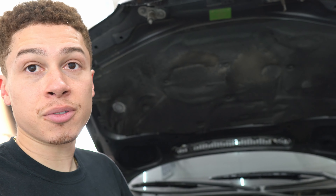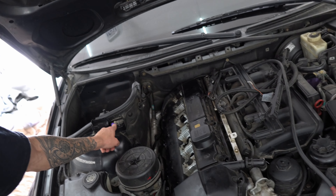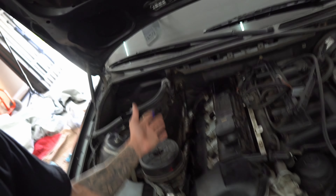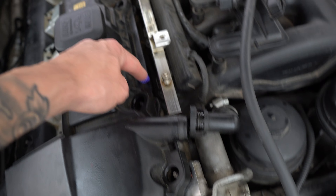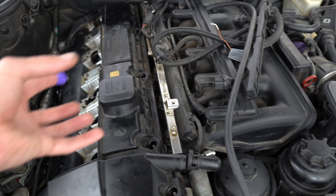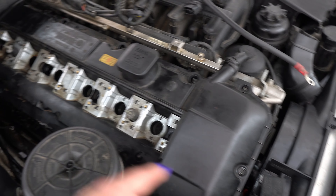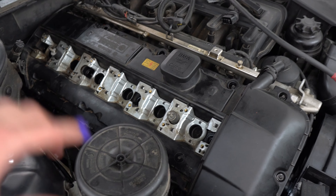So I just got the valve cover back on — that was a huge pain. The issue I ran into is that the gasket seemed too thin for the valve cover, so every time I'd flip it over to place it back on the block, the gasket would just fall out. A couple of things I did to help: I took off this cable which wasn't giving me a good angle, and I ended up using some gasket maker, placing it in certain areas along the inside of the valve cover. I let it sit for about five minutes so when I flipped it over it held the gasket in place. Now that it's back on, place all the bolts where they belong — hand tighten them first. Then torque them down to spec following a star pattern so the whole valve cover goes down evenly. The torque spec is 10 Newton-meters, which is roughly 7 foot-pounds of torque.